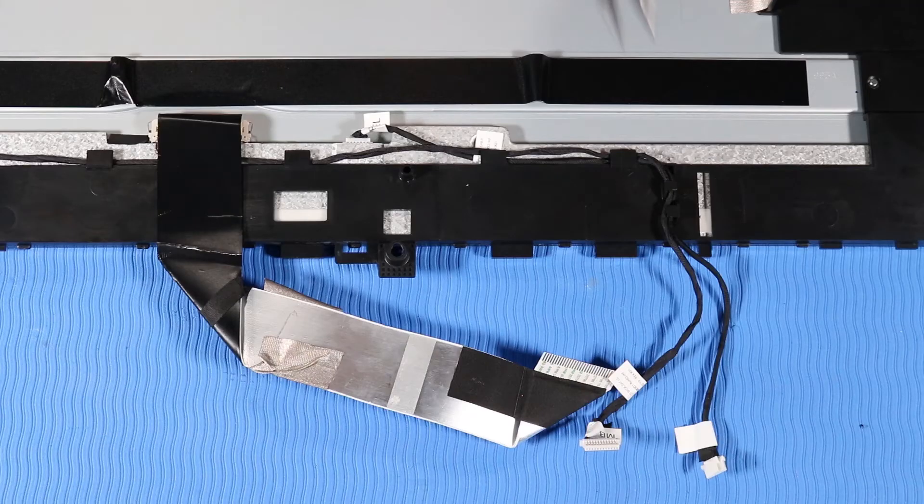Removal Important! This video shows the touch control board cable removal for the 24-inch platform. While the removal procedure will be similar, other sizes and configurations may have varying cables, routing channels, and connector types. Pay careful attention to the routing and connector type of the cables on the unit that you are working with.